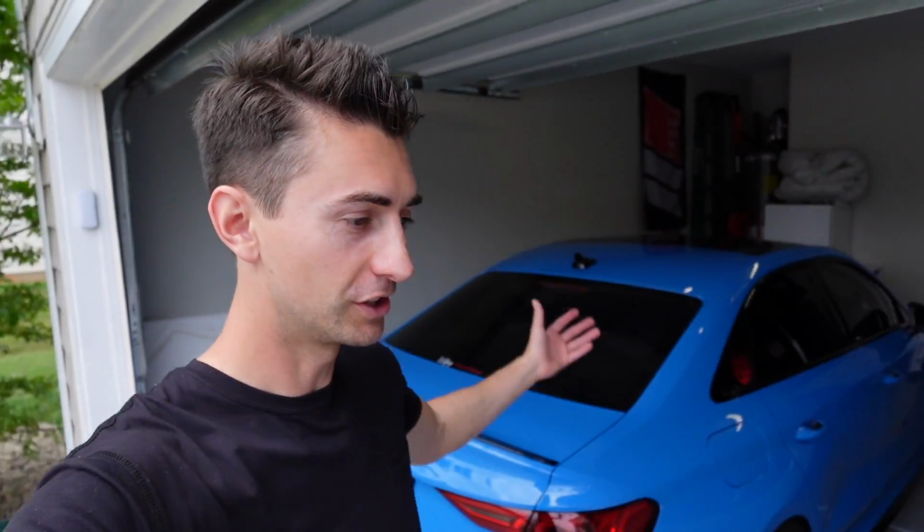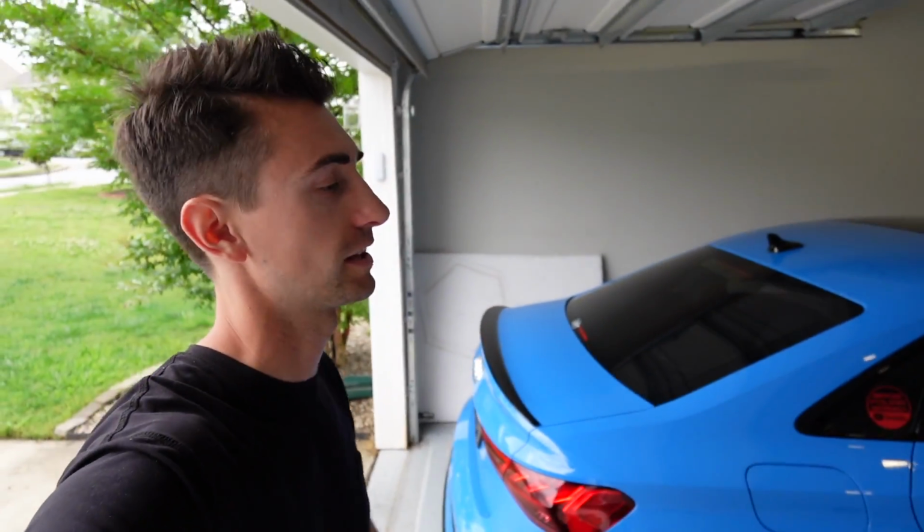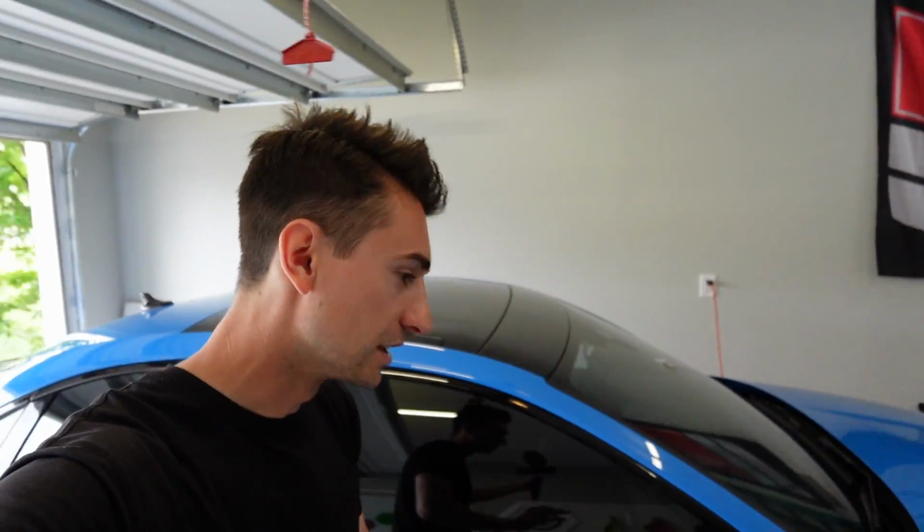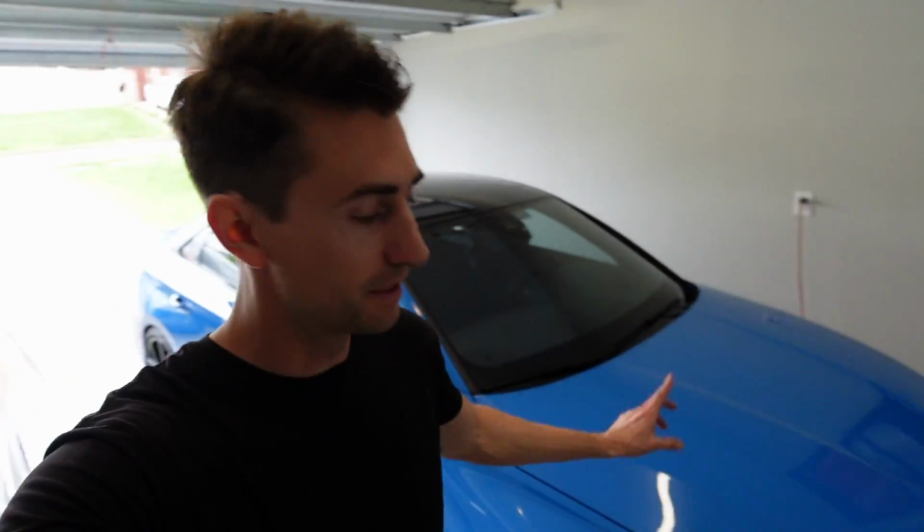All right, there we go. After driving in the RS3 with those new rear sway bar end links, that makes a sweet difference. It totally makes the rear end of the car just a little bit more tight, more responsive, and the rear end and front end now are working together the way it should in your typical sports car. So this car's definitely got some interesting handling characteristics due to the wider front wheels, the wider front track, the front wheel drive bias system. So it's a little odd, not quite what I'm used to. That definitely made a good difference, and they're incredibly inexpensive.